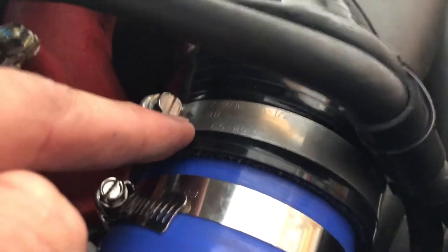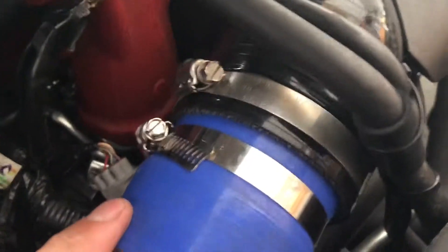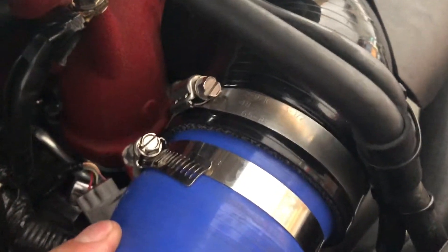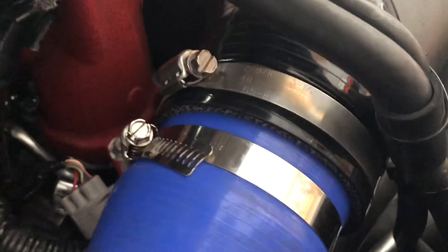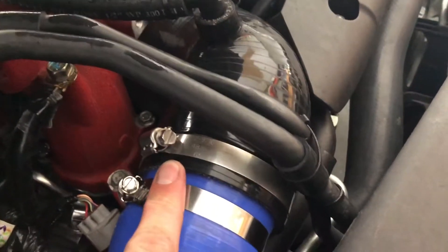Okay, and there's zero. A couple of things: first, where I've got the PCV plug here, I just couldn't get a good seal on that so it is hissing a little bit — losing a little bit there — but it's still allowing me to pressurize the system, which is all that matters. The first thing I found: this hose clamp here which holds the little aluminum reducer coupler — the one the aftermarket tube bolt-clamps to — was loose, and that was from the factory. I never touched that clamp, didn't think about it. As soon as I pressurized it, it started hissing like crazy and actually blew the coupling off at only a few psi. I tried reusing their clamp a few times and it kept blowing off, so this is a different clamp I found. I tightened the hell out of it and it seems good.